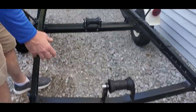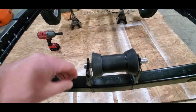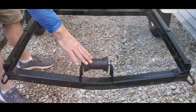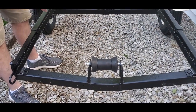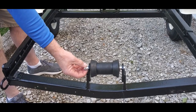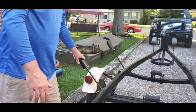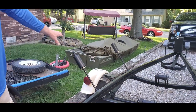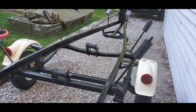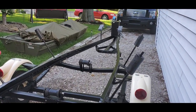Getting into the very back section, you can see the old keel rollers — there's three of them. You don't actually need keel rollers; bunk boards would be just fine for a Jon boat, but that's what it had. We replaced all three of the keel rollers because they were dry-rotted. Scott went in, and the axles that were steel were all rusted up and nasty — he milled brand new axles out of aluminum with brand new keel rollers. We also repainted the side rollers and redid those as well. When it's all said and done, I thought it came out pretty snazzy for just an old-school boat trailer for a Jon boat. A little carried away maybe, but we're happy with it.